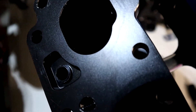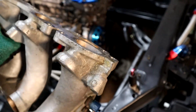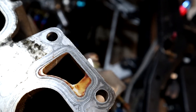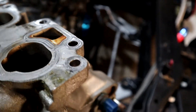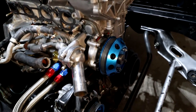There's a similar coolant passage on the MP Boosted manifold, and this is the stock one. The first thing to note is the reduced area that the coolant is flowing through on the MP Boosted. I'm not sure what effect that actually has on coolant flow, but I came to the conclusion that it probably won't matter too much. When the engine is cold, there's more coolant flowing through here, but it's only to the heater core and the throttle body. When the engine gets hot, everything goes through the radiator instead, so I don't think this is going to be too big of an issue.